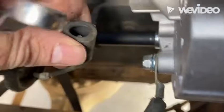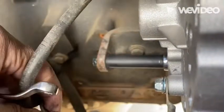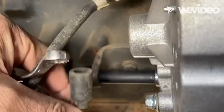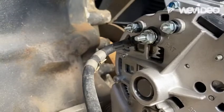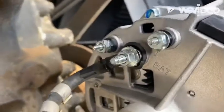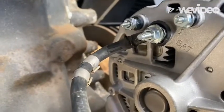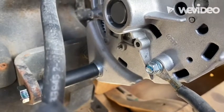The exciter wire that came off the old alternator — we are not going to use that. You can just either leave it hanging, put electrical tape around it, or tie it out of the way. For the new alternator install, you've only got two wires: your battery cable on the BAT terminal, which is 10mm, and the ground cable, which is 3/8.